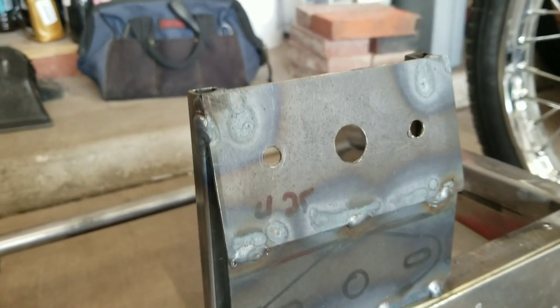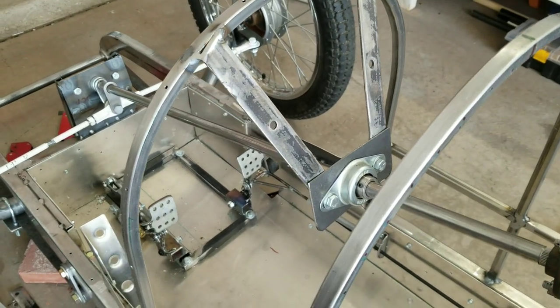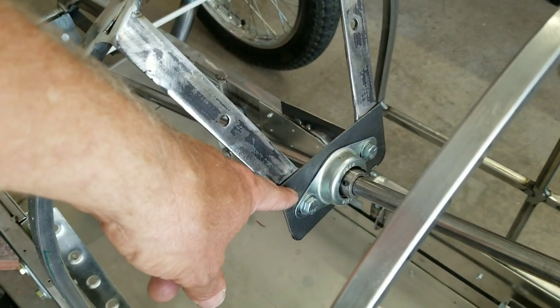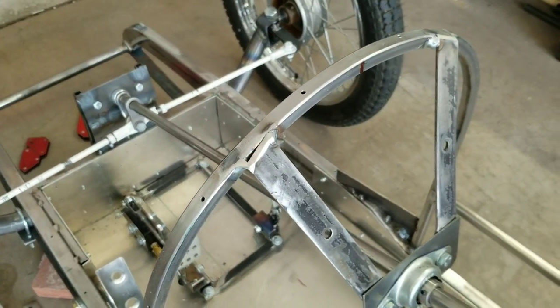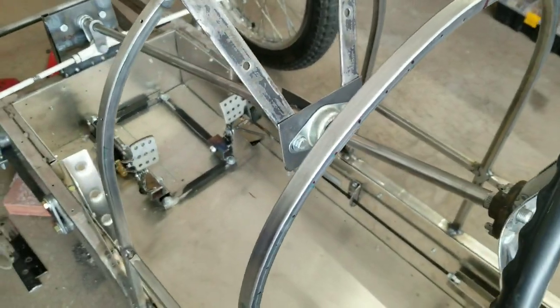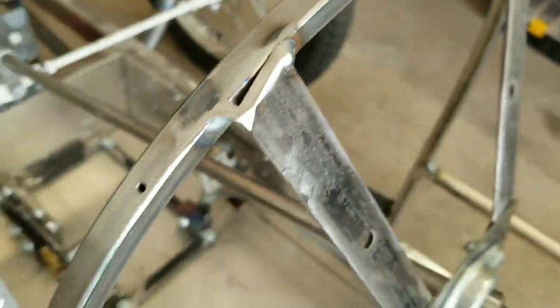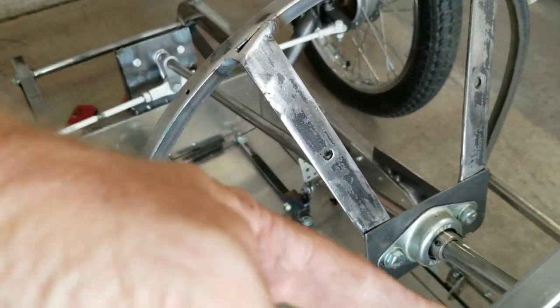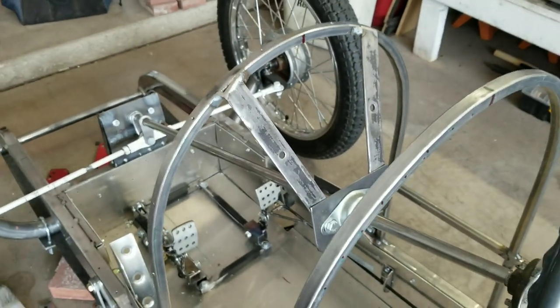Now we're going to rig up the front or the top one. Lower and upper mount are done. I've got to finish weld this — I just cut off these straps. What this is, is some strapping left over from a fence project. This is going to weld here but be bolted on here, because once we put our quick release on the shaft and the pitman arms are welded on, this won't be removable. So we want this to be able to be unbolted from the car to take the steering column out if ever needed — two bolts. This little plate will remove along with the bearing. I'm going to gusset this strap a little bit, but right now it's pretty sturdy.